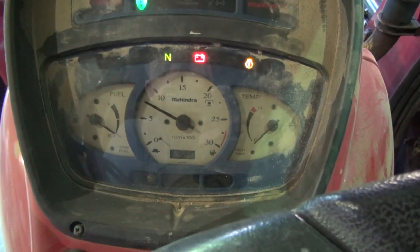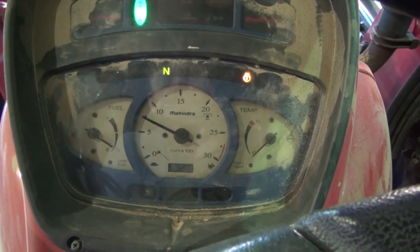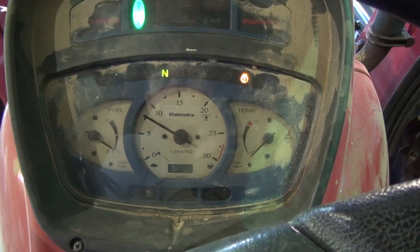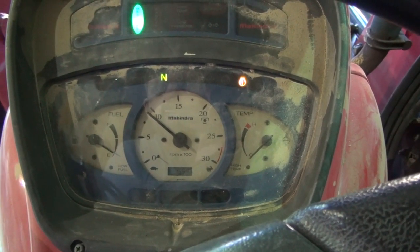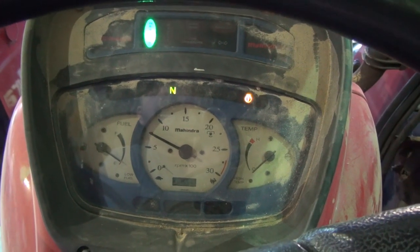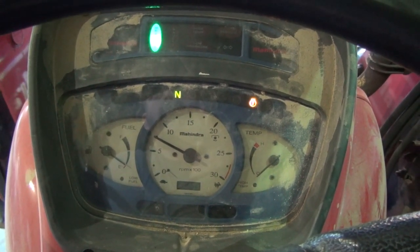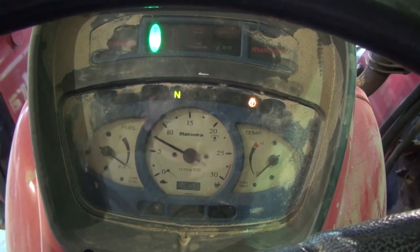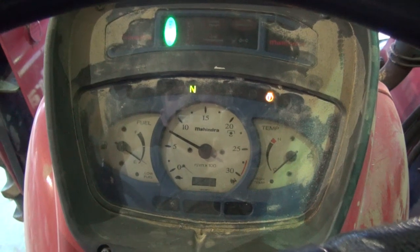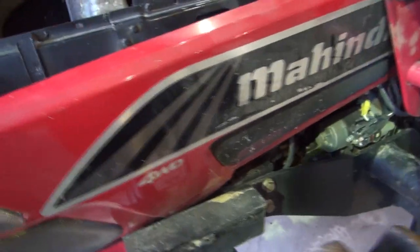You give it just a little bit of throttle and you can see the battery light went out. Somewhere in that range you can idle up just a little bit if you want, but it was idling originally about there. I like it about right there — I have it setting about 750 RPM right now and that's where it seems to be okay at. I don't like it being at 900 because it's a little too high.